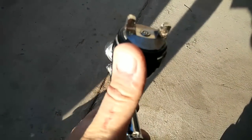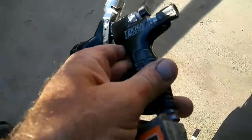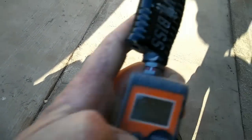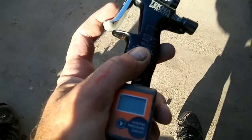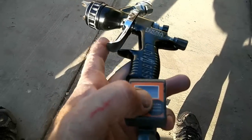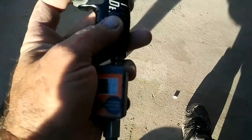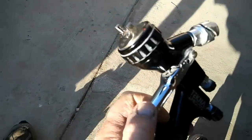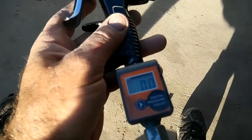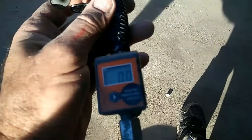At around 10 pounds pressure — check that right here with the digital gauge — you hook this up to the air, pull the trigger in, and push the button while the trigger's in. It would read 14 pounds or 10 pounds or whatever with the trigger in. So you have air coming out of your air cap — just air, no paint — and you're just looking at the pressure.